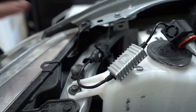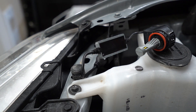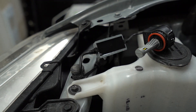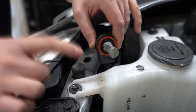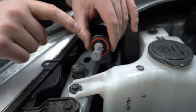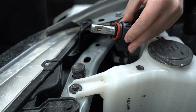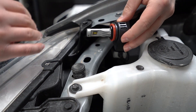Taking the SL1 light, we're going to just plug it back in, just like that. Now you want to test it to make sure the wiring is in the right orientation. Perfect — saw it came on. Now it's super important that you put these back in the correct orientation. You want them to be firing out horizontally, so the LED diodes — you can see them on the sides there — we want them in this orientation going back into the headlight housing.